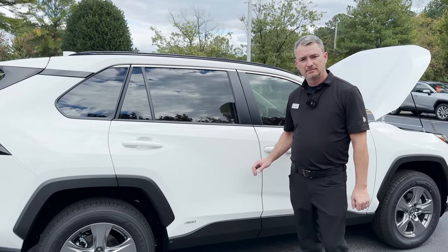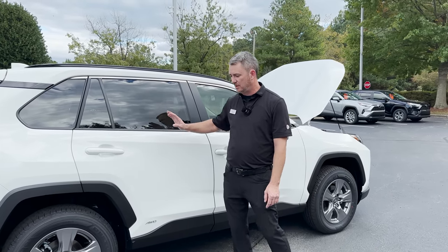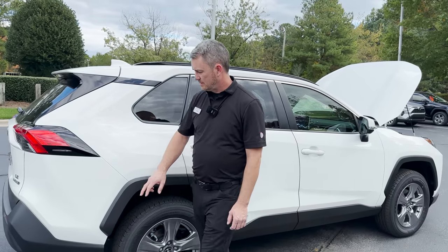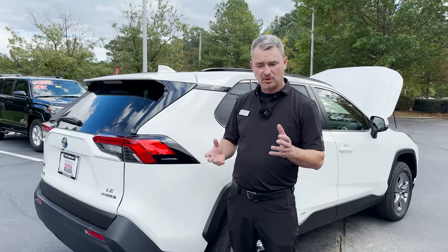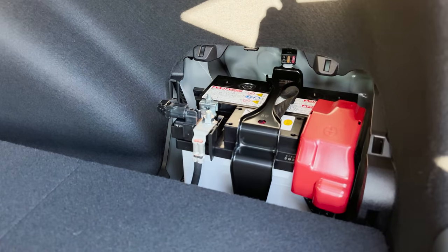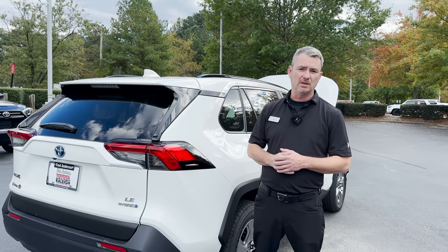What's interesting is that in an SUV like this one, you can lay the seats down flat. They're underneath the seat so it doesn't interfere with cargo space at all — it seems really well designed around cargo space. As for the traditional 12-volt battery, these use absorbed glass mat batteries, similar to Optima batteries you might see in a boat. They're mounted in the very back of the vehicle. We use absorbed glass mat because they don't produce as much hydrogen gas as a normal car battery mounted under the hood. They have a small tube to allow off-gassing to go outside, so you never smell battery smells inside the vehicle.